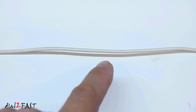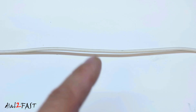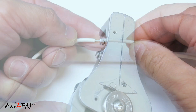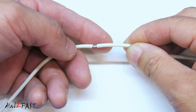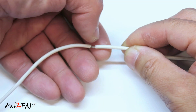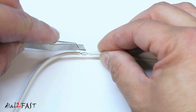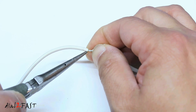So let's say this is a wire in the vehicle and I want to splice onto this wire but I don't want to cut it. I'll show you how to tap onto this wire without cutting it. I'll use this wire stripper and strip back part of the insulation. Now with this opening, you can try to wrap the wire around it, but often if this is a thick wire, the insulation will push back to where it was covering the wire. So what I like to do is make a second cut about 1 and 1/8 inch from the first cut. Now with the two cuts made, use a knife and cut open the insulation right here. Remove this section.